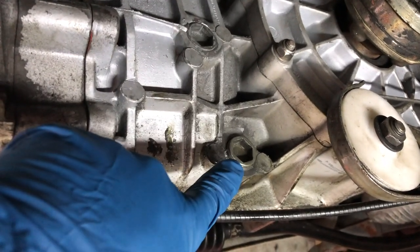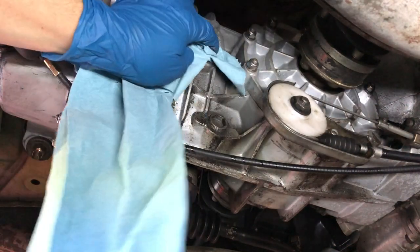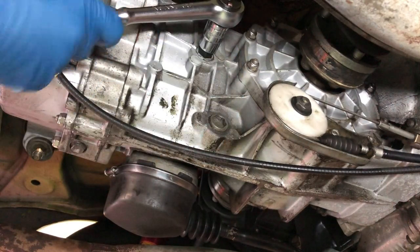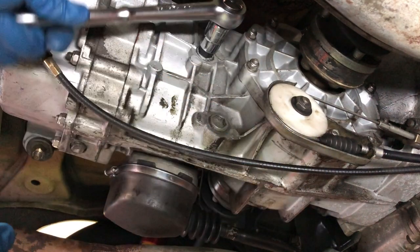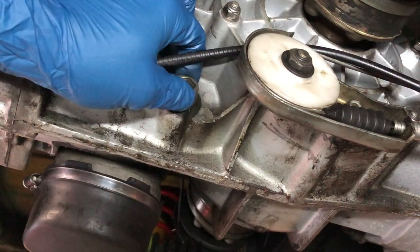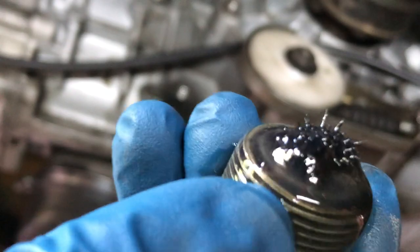Here on the right side of the transaxle you'll see the drain and fill plugs. Use some brake cleaner and towels to get any gunk out of the plugs so the hex bit can fully seat — you don't want to strip these. Use the 17mm hex on a wrench or breaker bar and open the top plug first, because it would really suck to drain the case and then discover you can't fill it back up. Put the pan underneath and open the drain plug. The drain plug has a small magnet built into it and it's totally normal to see some metal slivers on it — the magnet catches those slivers and does not give them up easily, so you're probably going to fight a bit to get that plug clean.